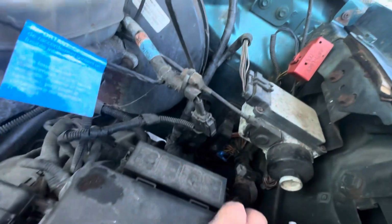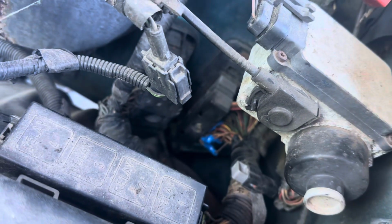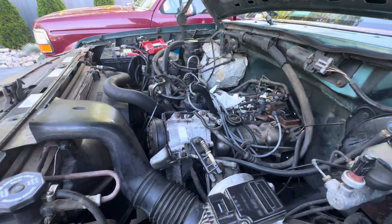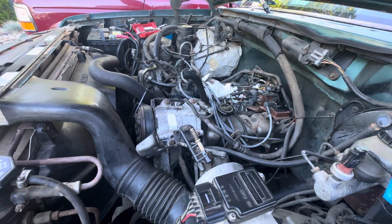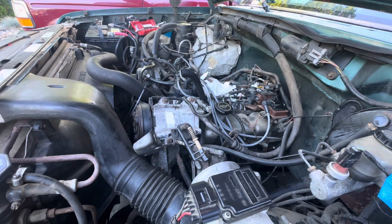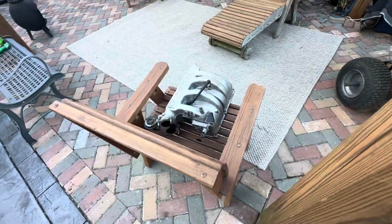So if you see the blue connectors down there, focus, damn you. Anyways, those blue connectors are where the fuel injection wires are. And so I crisscrossed the cylinders to get the timing right. Now it's firing on the right timing, but it's still misfiring. So as you can tell, the whole top of the freaking motor is over here. That right there is another problem with it.